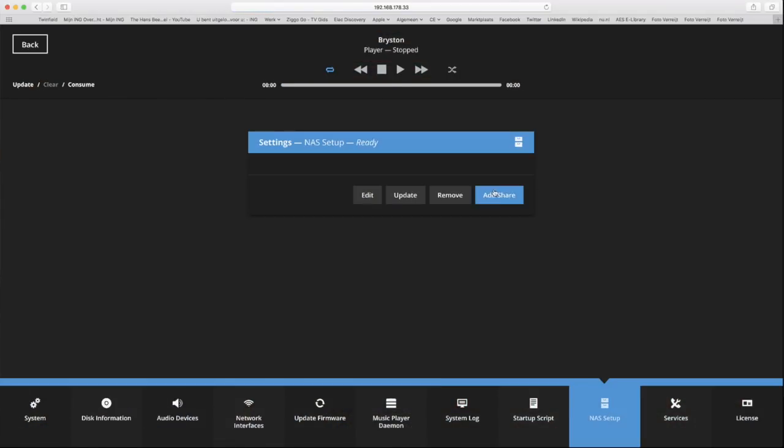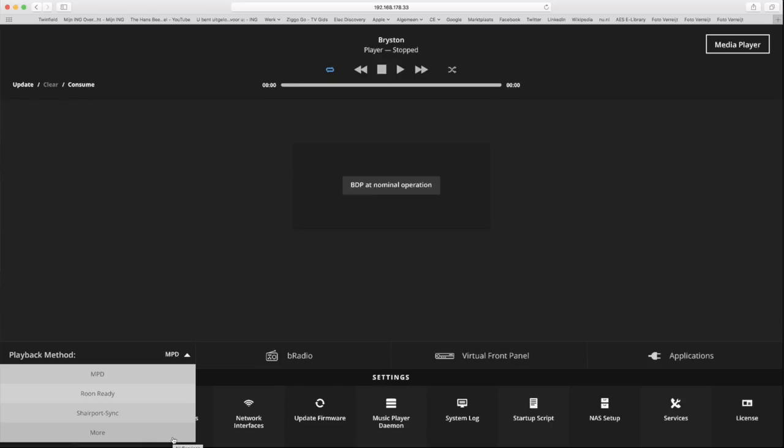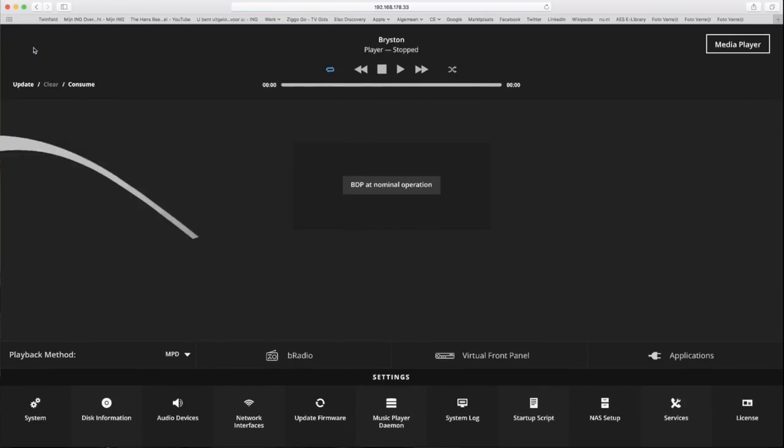Here you do the settings like what network shares hold your music, what DAC to use and so on. Here you also choose whether you want the BDP-Pi to work as an MPD player, Rune endpoint, AirPlay station, DLNA server, renderer or client or Squeezebox. It is easy to set. If you want music to play continuously, for instance if you own a pub, it has provisions to start playing immediately after startup and restarts MPD if something went wrong. It also has proper internet radio provisions and a beta version of a Tidal player. I'm not going through all the possibilities here, since you can easily download the Manic Moose manual from the Bryston site.